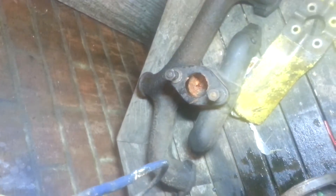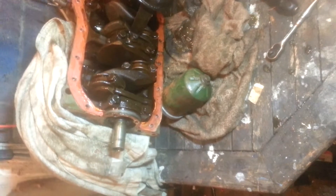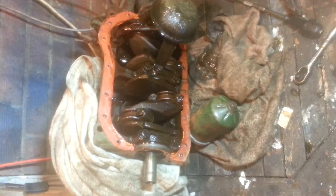A little bit of panic about that rust in there — not to worry, it didn't get in the engine. But now I've taken it apart it's going to take me ages to clean that up and rebuild it and check all the oil ways are clear — massive job. But it'll be worth it, because when it was going it had crank rattle, big end rattle, the pistons were slopping about, and a cloud of smoke. So that definitely needs a rebuild.